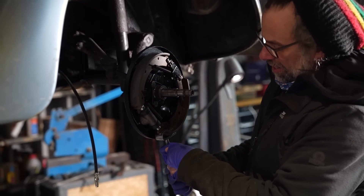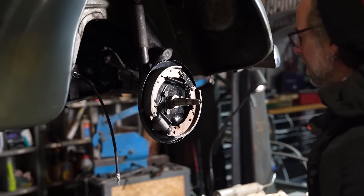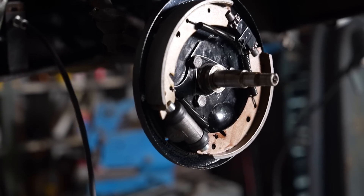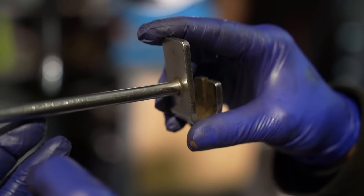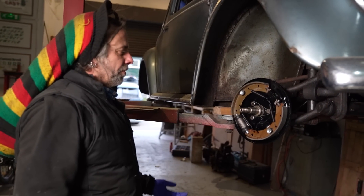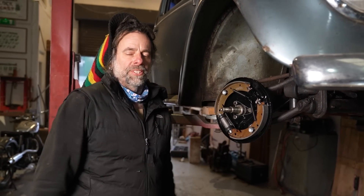Look at the leverage! Done. Girling - it's probably about 50 years old. Someone handed it down to me years ago. Is that actually for putting shoes on? That's exactly what it's for. All together - shoes on, wheel cylinders, locked off, hose is complete. Slide the drum on, on to the other side.